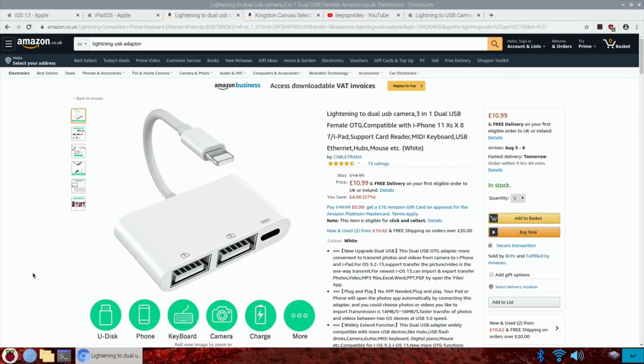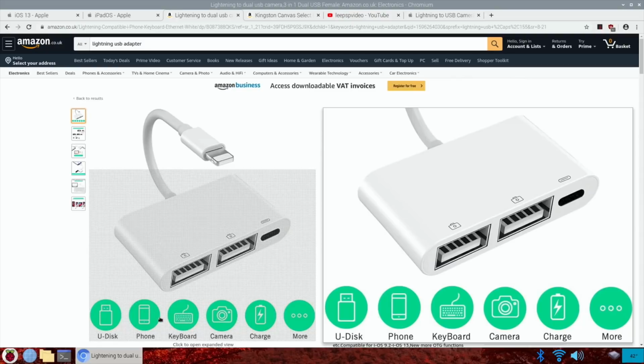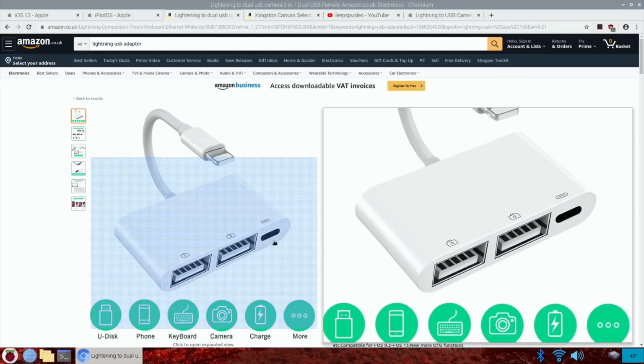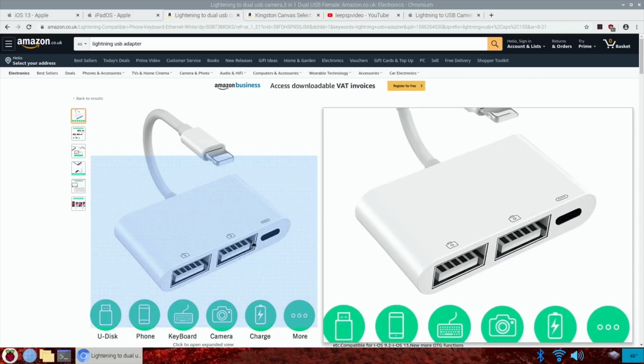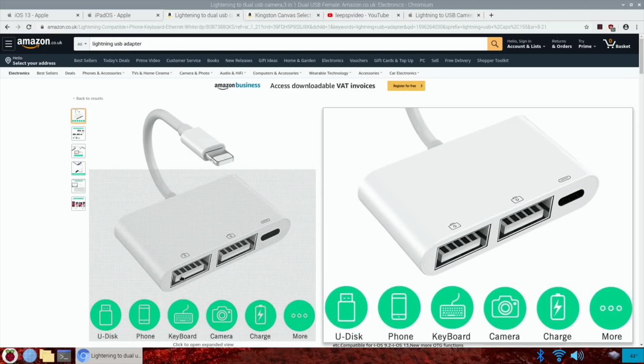So if I go to this one, interesting to see in the description that Lightning is spelt wrong. It's got two USB sockets on it, so you can plug in USB devices. You can see on here, you can plug in a keyboard, a camera, you can charge it, and so on. It's the charging bit that's important. You can plug your Lightning cable into this slot, and that means that it still powers the phone while you're using it to transfer data. So then we can plug in a normal SD card USB adapter into one of these sockets and plug the SD card into that. It also means that in the future, if you want to back things up from your phone or just transfer files, you can do that.